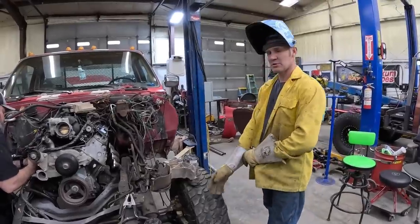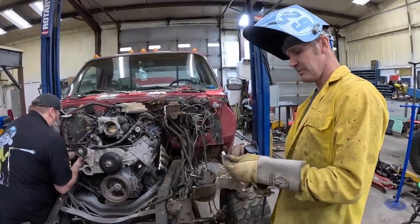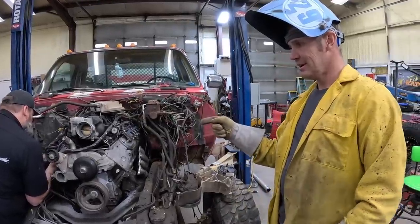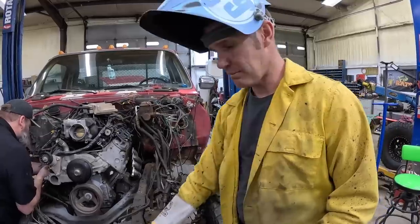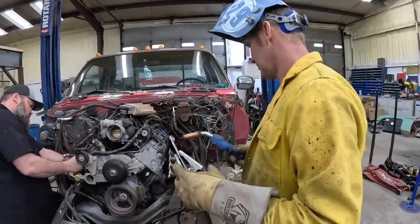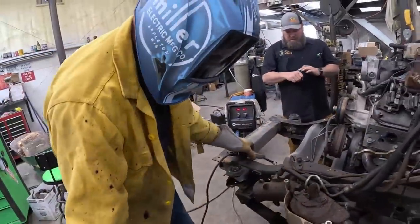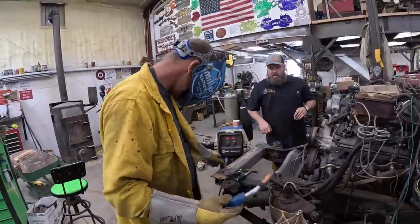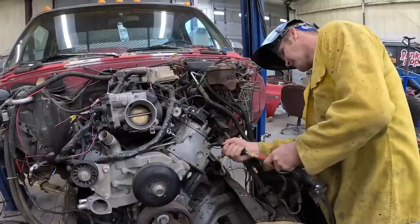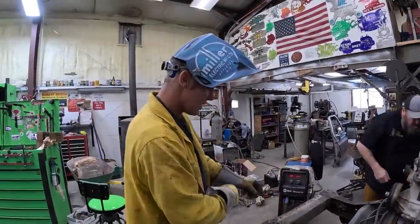All right, this has got the normal LS broken bolt. You've seen me do this a few times. This one's different because someone's tried to drill it and they've broken an easy out inside the bolt. So we're gonna see if we can't get crazy and weld something to it and get it to come out. All right, we've got problems. Can't see it? Silicone. I gotta buff it off. All right, we cleaned all the blue silicone off, so it will arc here.